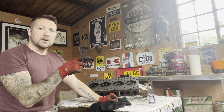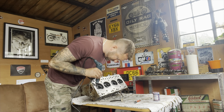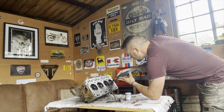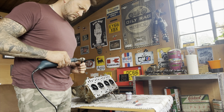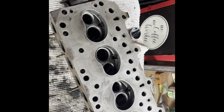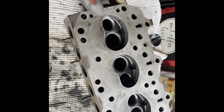This is a good way to spend a rainy afternoon. You can see here — this is where the valve has got to sit into, so we're looking for any scoring or pitting. It probably looks worse on camera than it actually is because of reflections and carbon build-up, but they're not too bad at all. To re-grind them, we push the valve in, then from this side we twist it. You can hear it making a good seal. I'm going to go ahead and do all of these anyway so I know it's been done. We can see it's started to clean away the crud.